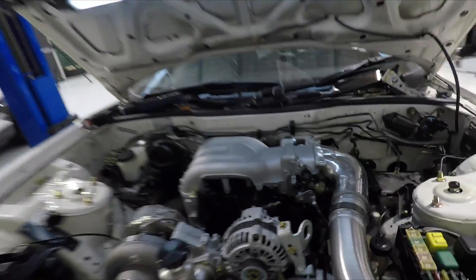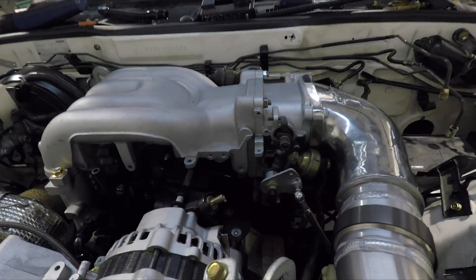The other thing we've done with the Mazda RX7 throttle body is we've removed one of the return springs, which is going to require a bit of testing. There is still a return spring in there, but what we want to do is make sure we're not overpowering the drive-by-wire throttle motor. If it has to overcome too much spring pressure it could be problematic. The drive-by-wire motor does have its own internal return spring so we're not eliminating the safety aspects, but it'll be a trial and error.